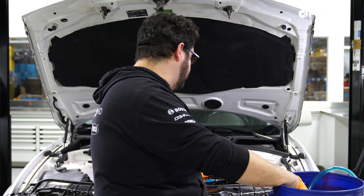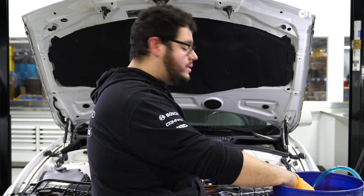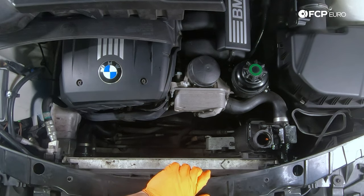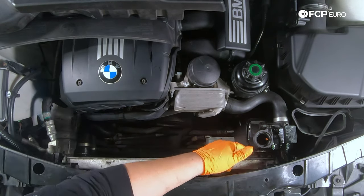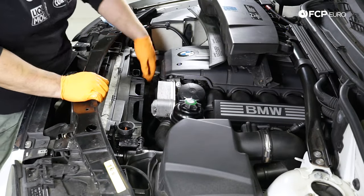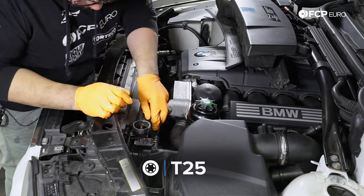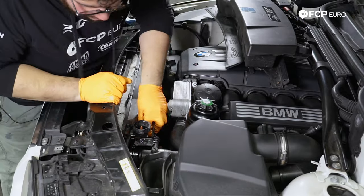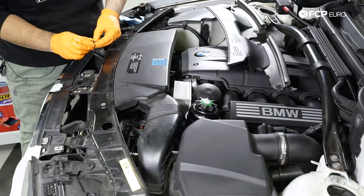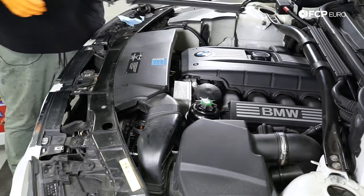The vacuum filler has done its job — our system held at 26 inches of vacuum. We're going to reinstall the ducting and still run the electronic bleed procedure with the pump as insurance; it's not strictly needed with this filler, but it never hurts to double-check. Feed the fan shroud back in — held in by a T25 and a plastic rivet. If it's clipped in properly, it won't go anywhere even without the hardware. Then reinstall the inner ducting piece, get the T30s situated by hand first, and zap them in with the impact. The front piece is held on by four T30s.